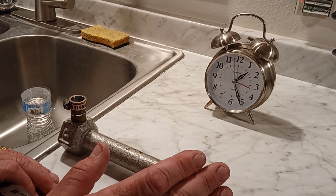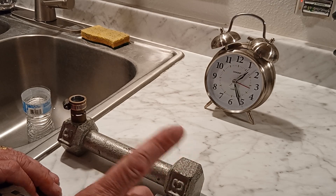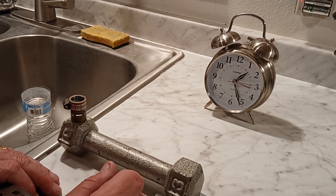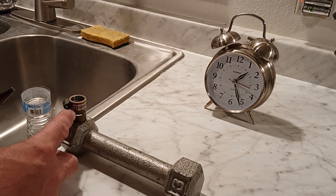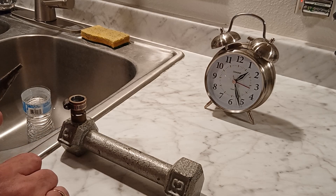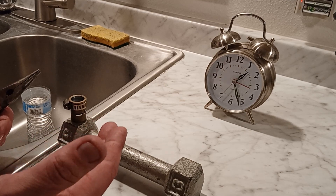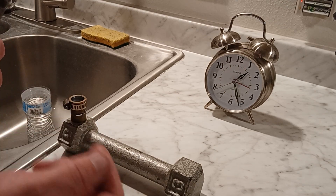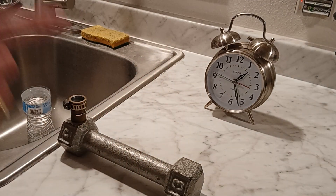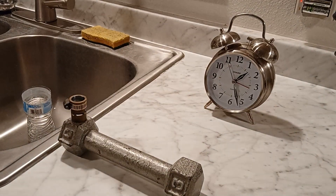Now, doing this method — I've done this plenty of times — I have messed up sleeves doing this. You can over-pinch. If you heat it up too long, you go to put your piston in and it stops dead way down there and won't go up. What I do is play it safe on the low side. If I have to heat it again, that's fine. You don't want to overdo it — under-doing it is fine, you can always do it again. Over-doing it, no good.